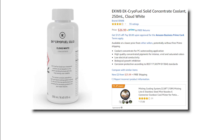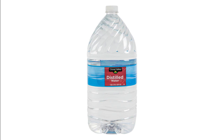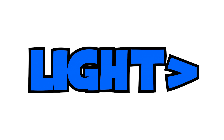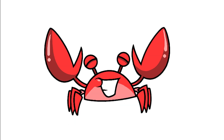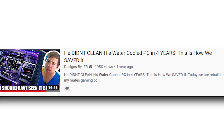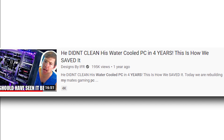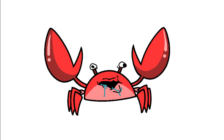Moving on to coolant: you will either need a pre-packaged anti-corrosive mix, usually dyed or clear, or just some distilled water — not tap water. To make sure your parts are safe, try to use light dye coolants rather than heavy ones. But if you do use thicker coolants like the Primo Chill View, make sure to drain and clean your system regularly so they don't build up on your CPU and GPU blocks, making your temps higher and making it a pain to clean. Overall, it's a good bet to change your system's liquid around 2-3 times a year — but if you want your parts to last long and be more efficient, clean out your water.